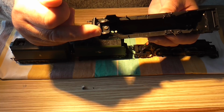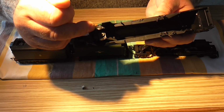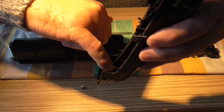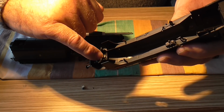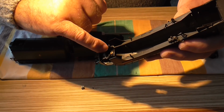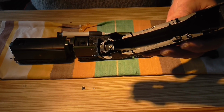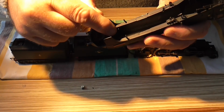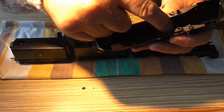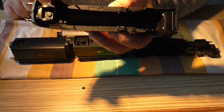So at this end, the front, I have 2 lamps, one coming through there, one coming through there, and then I daisy chain them so they go underneath this lip here, so they're out of the way where the screw is, and that screws onto the chassis. So the wiring goes underneath there, and these 2 will be daisy chained together. So I'll end up with 1 blue wire and 1 yellow. I think it's yellow for the front lights. It might be white. So I end up with 1 blue, 1 white, which I'll route either that side or that side.